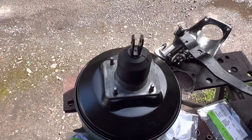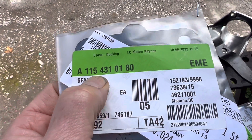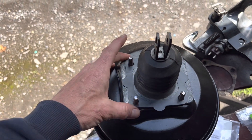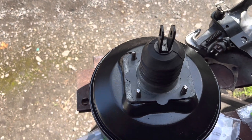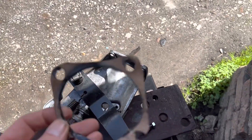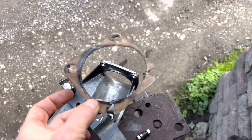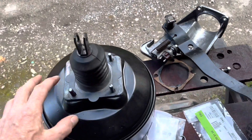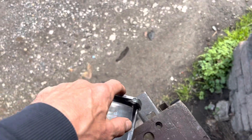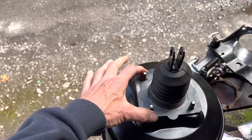Before you do that, I believe there should be a rubber gasket on there which is part number 115-431-0180. The Mercedes drawing is not entirely clear whether this gasket goes on the engine side of the firewall or inside the car. So what I've done is bought two of them, because when we took the pedal off the car there was a manky old leather or cardboard gasket attached to it. To me it would make sense that the gasket should be on this side to stop moisture getting into the car, but also on the other side to stop it scratching the paint when you bolt it down. They're not expensive — I've bought two with the intention of putting one on each side.